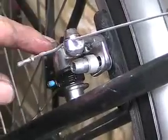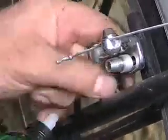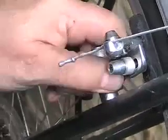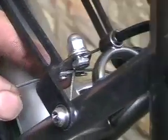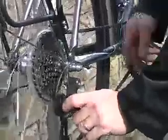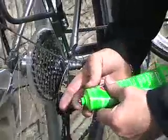The same rule applies to the brakes — lube any exposed springs. Add a drop of lube to brake straddle wires. For smooth gear changing and braking, use a teflon-based grease on gear and brake cables. Change into bottom gear to release the slack in the gear cable. Apply a light coating of grease — again, don't go crazy, a small amount will go a long way.